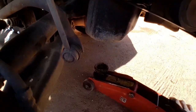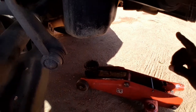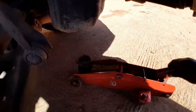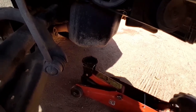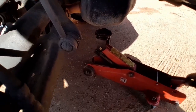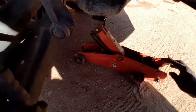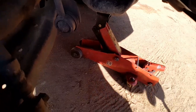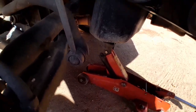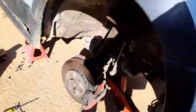Now that's out of the way, we can put up the jack and support the engine. You can support it at the sump - the sump is strong for that - or right over here. I like going directly underneath the sump to make sure this guy is covered. Give it just a little lift, then we can take off those 16mm bolts.